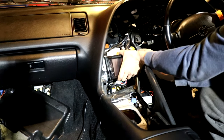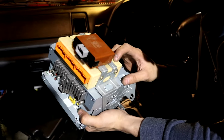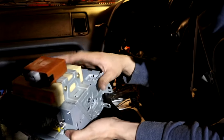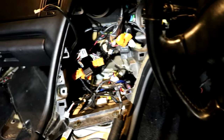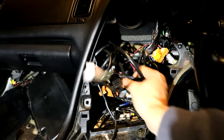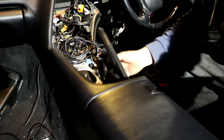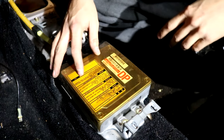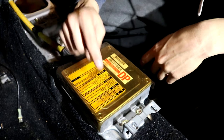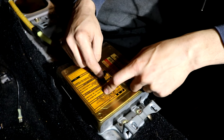I'm just trying to get the stereo out. ABS — I'll be deleting the ABS, so it looks like I can get rid of this. An antenna relay box — yeah, looks like I can get rid of both of these boxes, so that'll save me a lot of room behind the dash. What kind of wiring we're talking about here — this is all factory wiring, but you can see the AEM gauges and stuff just kind of shoved back there and I hate it. This one says airbag crash sensor unit — I should take the airbag out of the steering wheel since I'm going four-point harness. Maybe I don't need that — it'll be an executive decision.